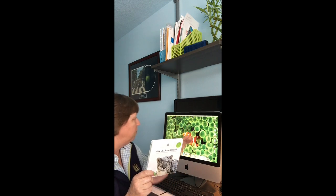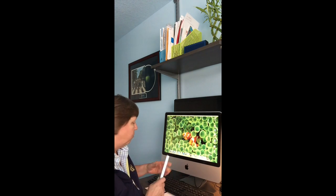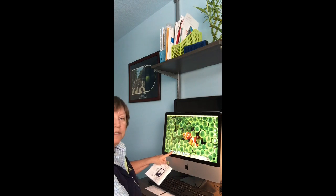Which brought us to 10.6. From that point, we actually had to go into the computer here. We had to have it check for updates. We downloaded all the latest updates. There were probably about 12 of them, which brought us to 10.6.8. Once we're on 10.6.8 of Snow Leopard, then it's really simple for us to go into the App Store, which is down here on the dock.